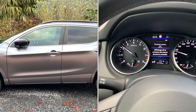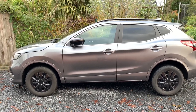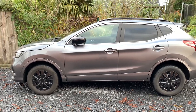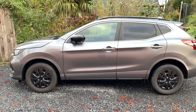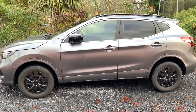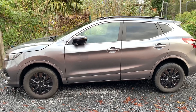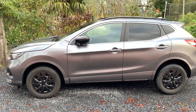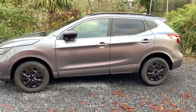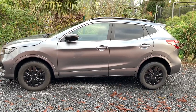First you can see some kind of error message, as I had here. Maybe the car was a bit confused because I was driving with these TPMS sensors and I also had my summer tires in the trunk with the sensors on them, so maybe the car has some difficulty to decide which ones are in use and which ones are just carried in the back. But after a couple of minutes and doing like 60 kilometers an hour and some turns, you will see the exact pressure will pop up by itself.